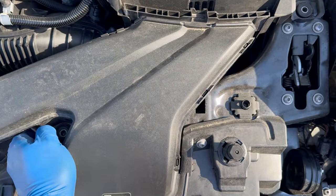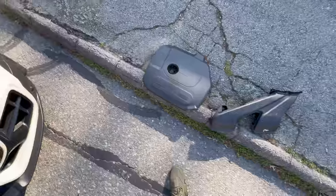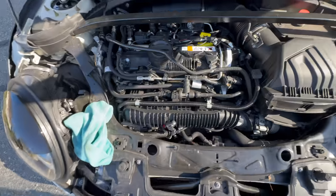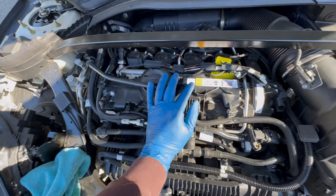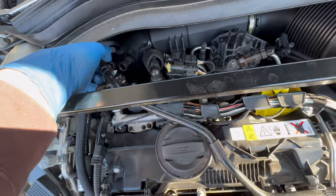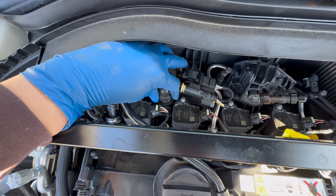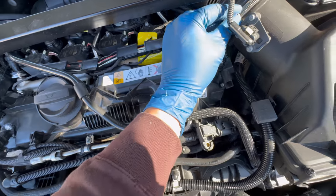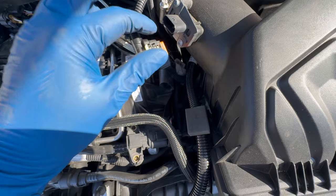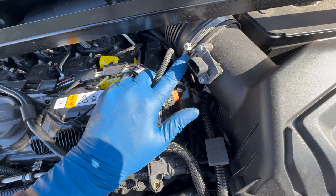It just comes up like so. Then you're gonna have to pull the coil pack cover, or the whole valve cover cover, to expose this. Then you grab these clips over here — these just pinch and pull. Another one back here, pinch and pull. One right here, pinch and pull. Then the clip right here — pull the little clear plastic clip back and that just slides back. Undo the flathead worm bolt clamp right there.